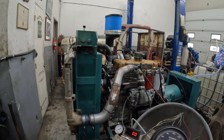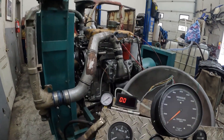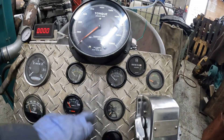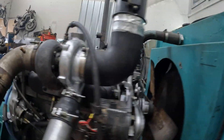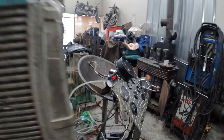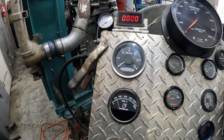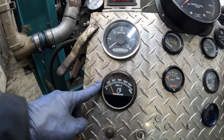Since Wednesday's dyno I've added a drive pressure gauge, just clamped on temporarily — I'll eventually put it in somewhere. The drive pressure line goes through some copper coiling out to that gauge. Here's the EGT probe. The EGT didn't seem to work very well so I used a torch on it and exercised it up to 1200 degrees. I've ordered a new gauge just in case this one's not very accurate.